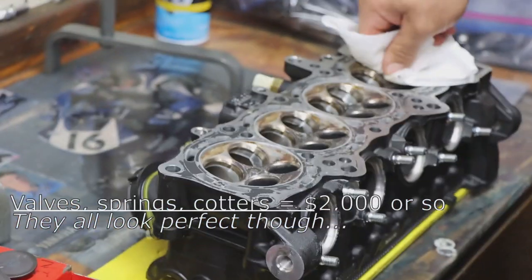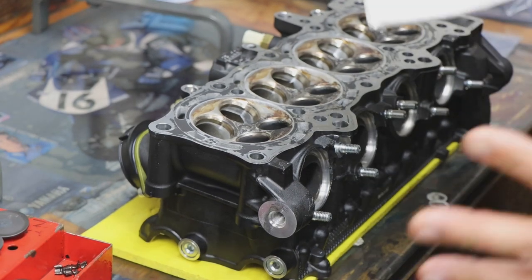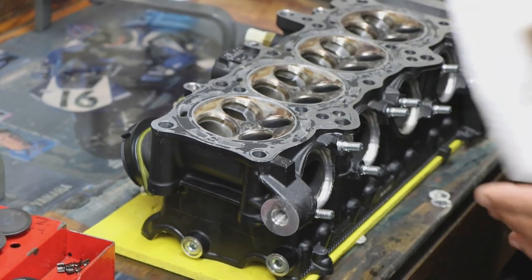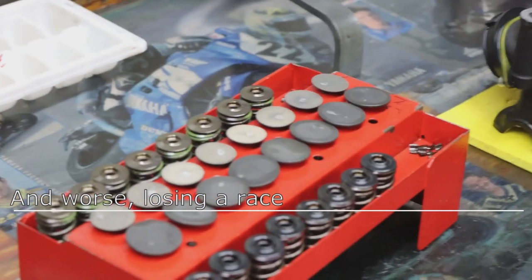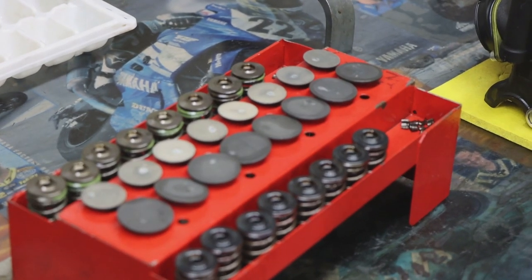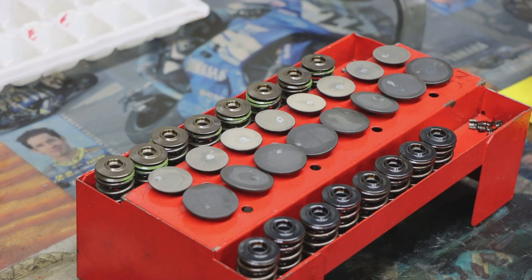But because this is an endurance motor, this is the most fallible part in the motor. If this fails, you lose your whole motor. One of these heads breaks off, it goes jingle, jingle, jingle inside your cylinder, you lose your piston, you lose your cylinder, you lose your head, because they generally will break at the highest RPM with the most load. It's like throwing a giant quarter or a half dollar in your cylinder and causing all kinds of damage.